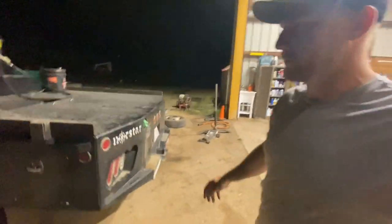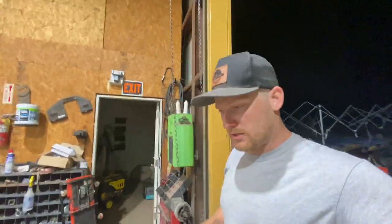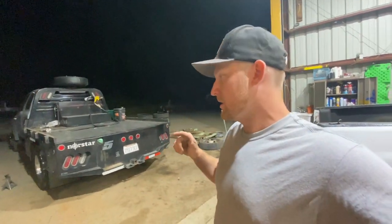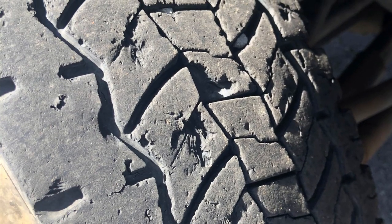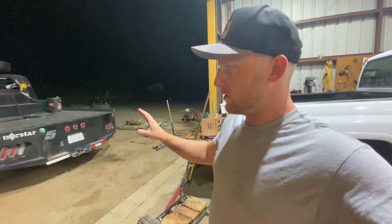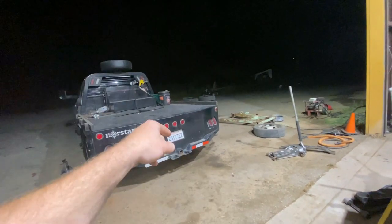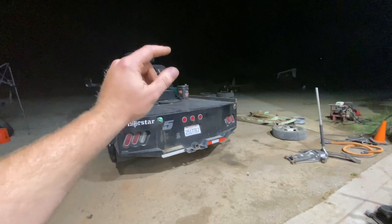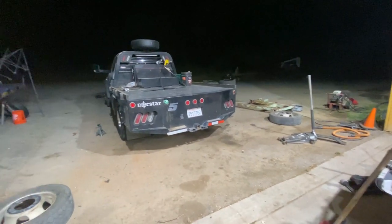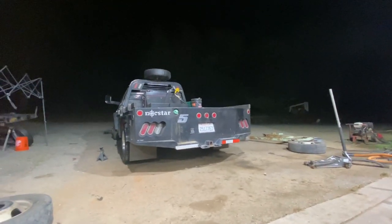Let's go ahead and wrap this one up — it's been a doozy but we've been learning about tires. Thankful to have the good treads on there. The info I got on those was from another guy that hauls stuff — hauls containers and various other things. I was gonna try Continentals but he recommended these after he tried them and they were starting to chip up. His showed wear at 47,000 miles versus these at 20,000 miles. A couple years ago I had a brake over there stick because the exhaust was banging on one of my brake lines and squished it — it was the hottest I've ever seen anything. I was towing up a hill, I thought it was the parking brake sticking, but nope, I needed a new caliper. The rotor was actually fine somehow.